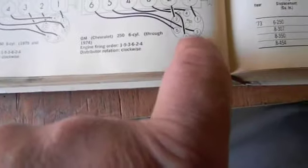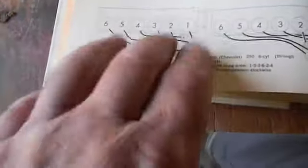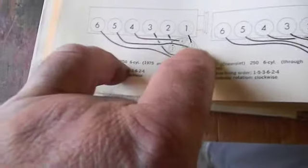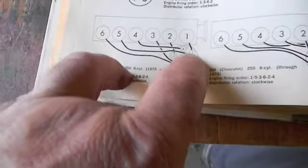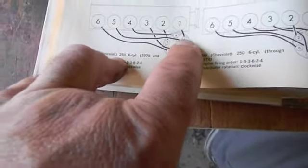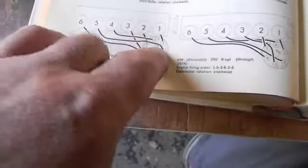That's mechanical vacuum advance, Ruben — we're going to set it to 10 before. They have '75 and later and up to '74, and the difference is you see two screws here for standard ignition, four screws for HEI. It doesn't matter where you put number one, but put it where they say — if you have fitted wires you'll wind up having a problem. They're showing number one here, roughly with the cap screw up against the block at cylinder one, and they want cylinder one right here.